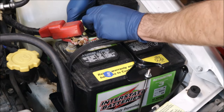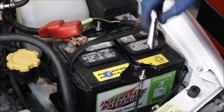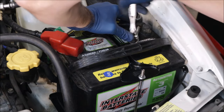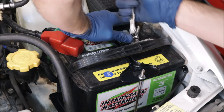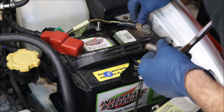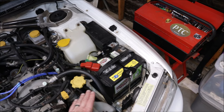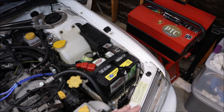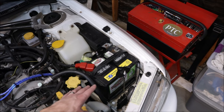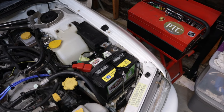I'm going to put it on. But of course, one of the bolts snapped on the terminal when I was trying to tighten it. So I've got to get a new nut and bolt so I can at least get the negative terminal on there. Underneath the battery tray, I was amazed — there was zero corrosion. I thought I was going to pull that out and just see bubbles on bubbles and white, rusty, melted paint. But guess what? It's clean as a whistle.